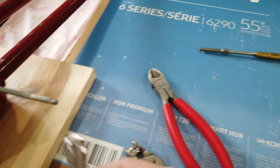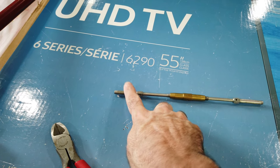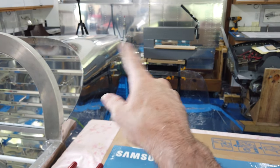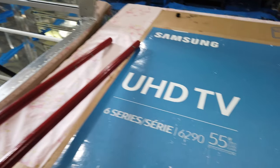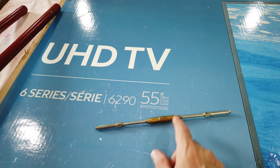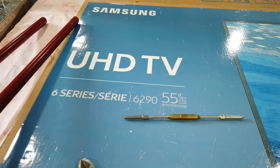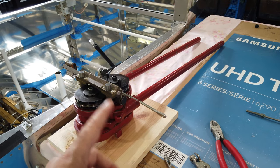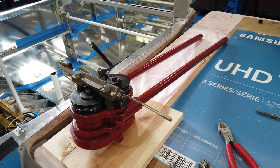That's the plan. Right now I'm just going to cut these off and install the forks. I'm not going to swage the turnbuckle fittings onto the cable until after I get the tail finally assembled, get my seats in, and can decide exactly where I want my pedals. Once I figure all that out, then I can figure out how much cable, if any, I need to cut out to put the turnbuckle in. So that's going to wait for another day. I'm just going to cut these ends off, put on my forks, swage them, and move on.